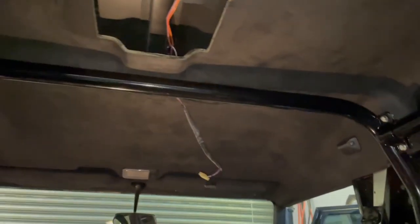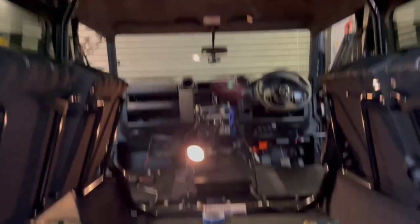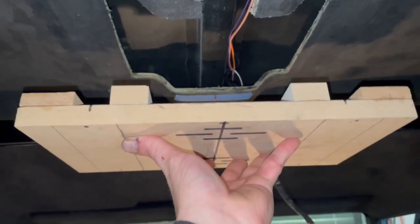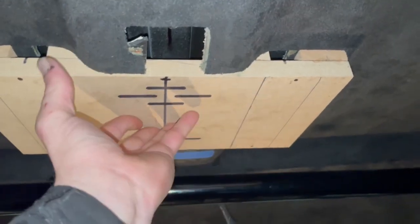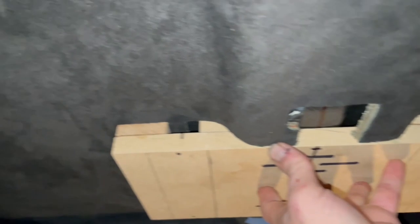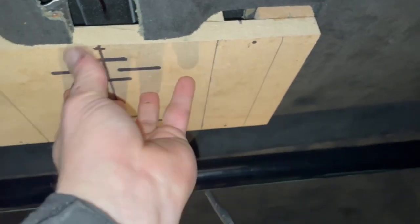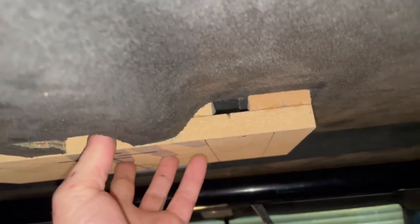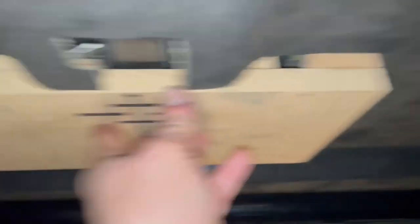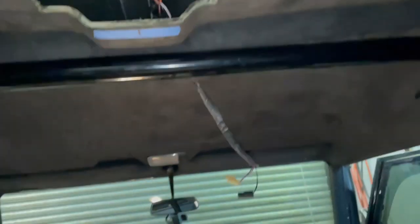No going back now - we've got the hole in there and you can see what I mean about that ridge bit. Let me show you how this wood piece is going to help. What it lets me do is hold the weight of the roof lining up onto that metal bar without the pressure coming through the screen mount, and it gives us a flat surface to mount the metal disc to. Those little inner ones are to stop the sides rocking. As you can see, it pins everything up nicely. This will get bolted up into that centre strut and I'll use some epoxy on those two points to fill out any gaps. The weight of this mainly isn't pushing down on the metal plate because the two wooden supports on the sides are pinning it up in there.